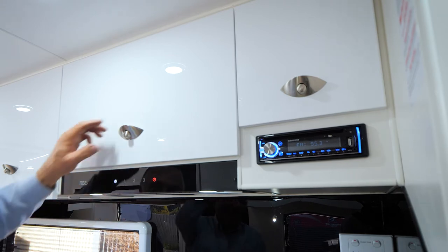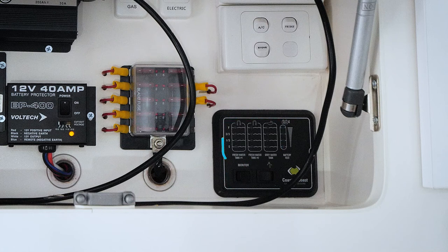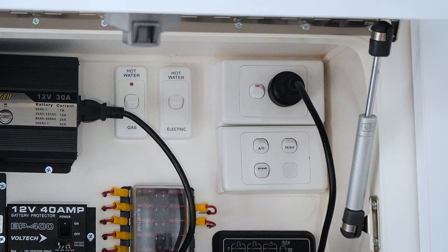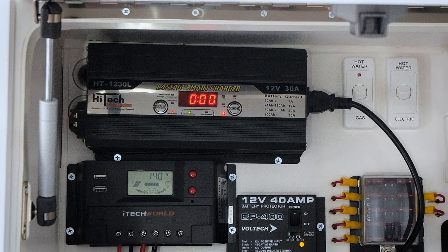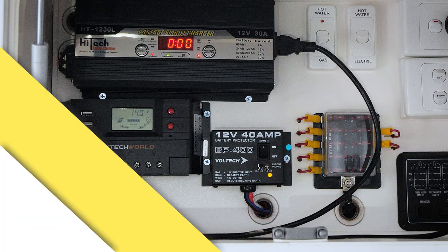This is like your engine room. Press this button and it'll tell you how much water you have in your two water tanks and also your grey water tank. Over here, this one tells you how much you've got in your battery. That's your water pump - you can turn that on separately. Up here are your isolation switches for your fridge, air conditioning, and stove. That's your hot water for electric, and that's your hot water for gas. This one tells you if you're plugged into 240 how your batteries are being charged. We're running on solar at the moment and it's putting in 14 - very good. Over here is your low voltage regulator - if your batteries go down too far and you don't have solar or shore power, it will turn those batteries off so you don't kill them altogether. And these are your fuses.